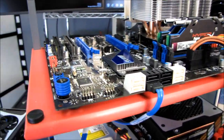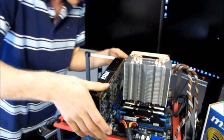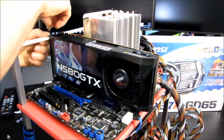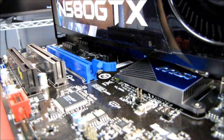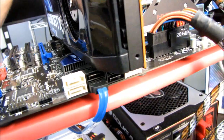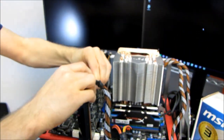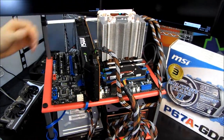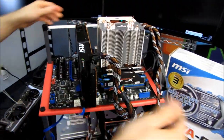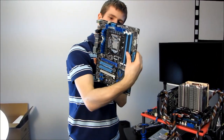I found another video card — we're going to plug in a GTX 580. I had a GTX 460 on there before, but I'll throw the highest-performance graphics card I have on hand onto the test platform. From now on, all results I provide will be using the LGA 1155 Sandy Bridge platform versus the older LGA 1156 Lynnfield platform. I'll find out what kind of overclock I can get on the 2600K, let you guys know, and then we'll go from there. That's the motherboard swap — complete.